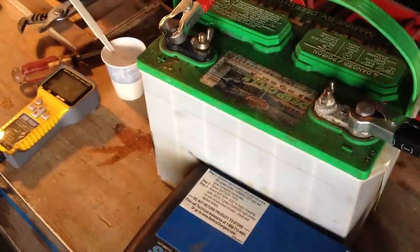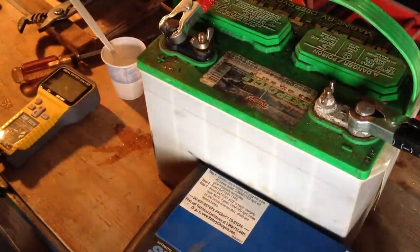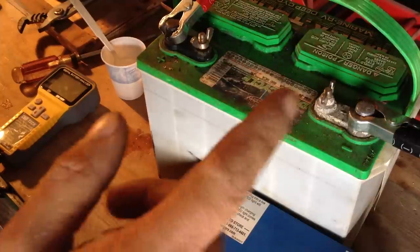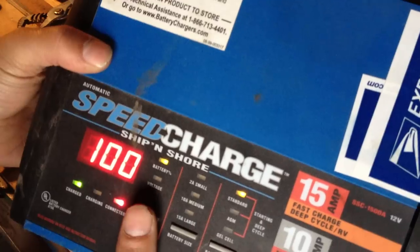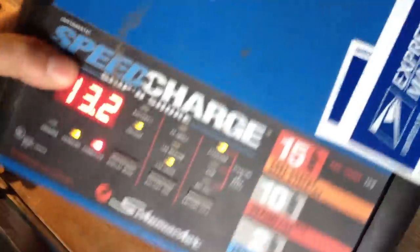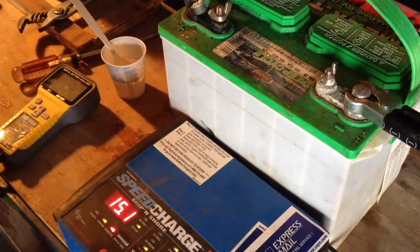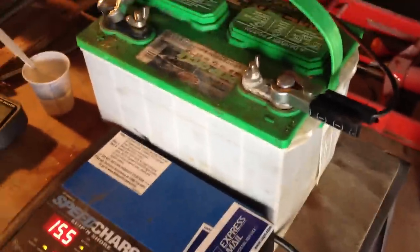See my other videos about the capacitive battery chargers for actual desulfation of batteries — it will not recover damaged cells, but it can reduce the sulfation. Actually, scratch that — we're going to go all the way to part five. The next part will be after this battery has had a complete charge with the Schumacher. Since the surface voltage hasn't settled yet and it thinks it's at 100% — it is not — I'll select 15 amp and let it go. First, we'll see what this one reads after a full charge, and then we'll use one of my capacitive battery chargers.